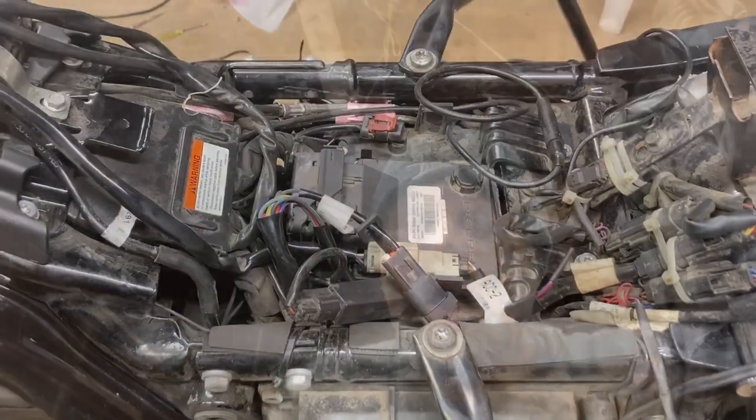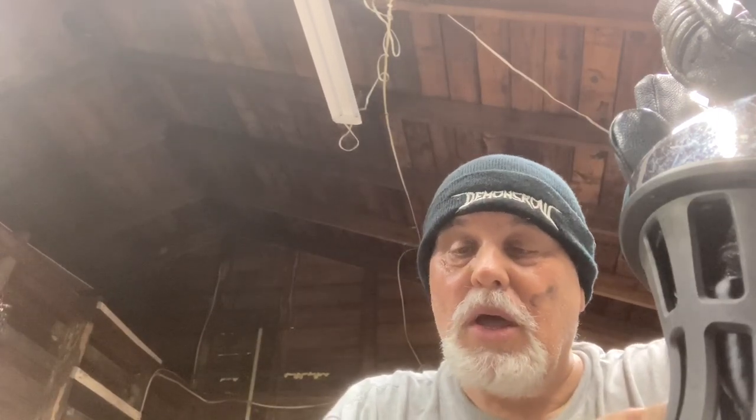Well, this is the Rogue Rider — I've got the accessory switches in. Now I need to get accessories for it. It's got two sets of wires. One thing I did learn is it's not a 20 amp on the power that goes directly to the battery — it's a 10 amp fuse which is under the seat, and it runs off a 20 amp fuse and a main breaker on the main circuit panel. I've got it arranged so if I have to change the fuse I just take the seat off and it's right there. It's also got accessory two — the center plug — which can be wired for anything through a relay and a 10 amp fuse: things like heated seats, heated vest, heated pants, or heated gloves, all running off a switch on your dash.